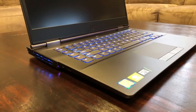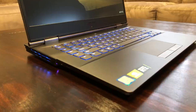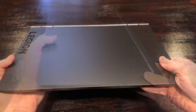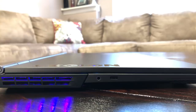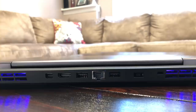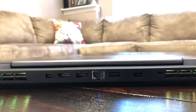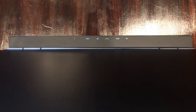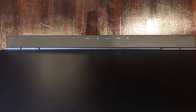So here it is, folks — the mullet of laptops. Business in the front, party in the rear. We have an all-aluminum build with a plastic area over the fan intake. On the left-hand side we have a microphone-headphone combo jack and a four-lane Thunderbolt 3. On the rear, we have the mini DisplayPort, HDMI 2.0, USB 3.1 Gen 1, a LAN port, a SuperSpeed USB 3.1, the proprietary power plug, and a lock. I like how Lenovo lights all of this up so when you're above the laptop you know where everything goes.